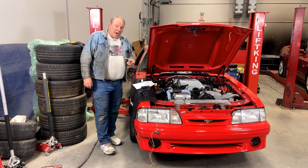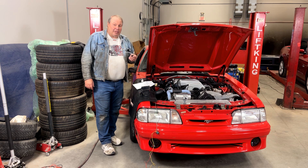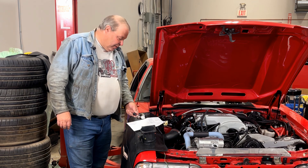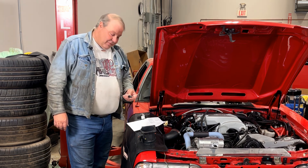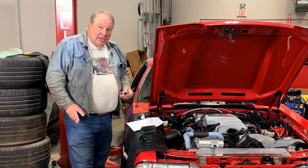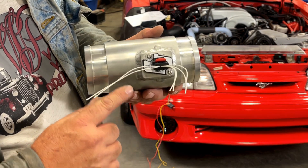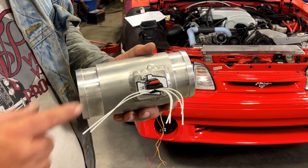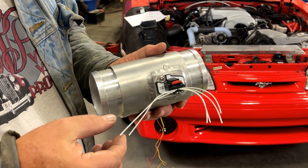The other thing you'll find on the wiring diagrams is that the slot MAF labels the pins one through six, not A through F. So here's a cross-reference: A is pin six, B is pin five, C is pin four, and D is pin three. That's all we care about for the Foxbody conversion. An easy way to tell what's what — look for the flow indication on the slot MAF. Even though this SCT BA5000 doesn't have the pin numbers labeled, it does have flow labeled, and all of them should have that. The flow direction indicates pin one, and the downstream end is pin six.